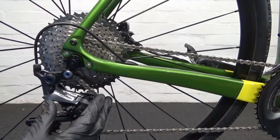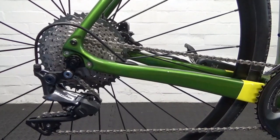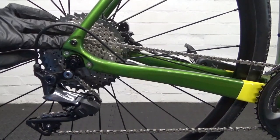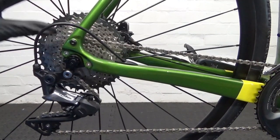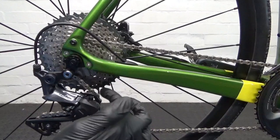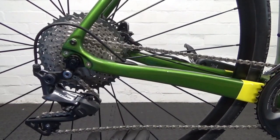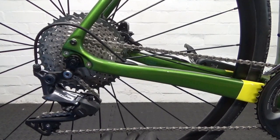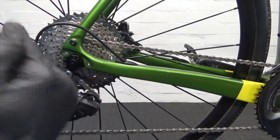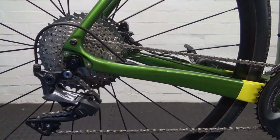Right, so there's the install complete. I haven't touched any screws other than the B screw — the high and low adjustment screws and hex heads haven't been touched. Obviously the bike had an 11-speed cassette on it before, so it doesn't need any adjustments made to those screws. All I've done is adjust the B screw so the guide wheel misses the 40 tooth on the back, and obviously resize the chain. Like I said, you can keep one chain for the 40 tooth and one for the 32 if you want to swap back. So hope you found the video helpful — if you did, remember to give it a thumbs up, subscribe to the channel for more cycle-related content. Ride safe and I'll see you then.